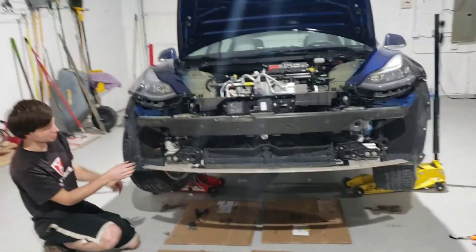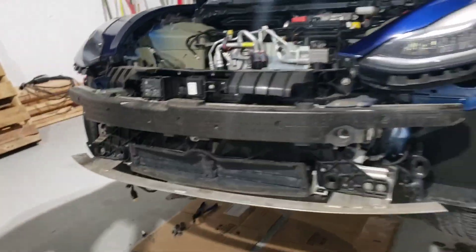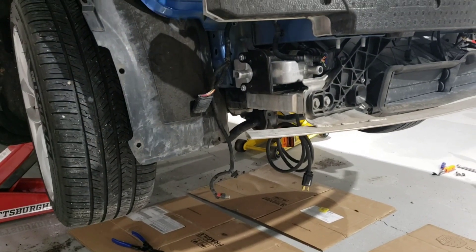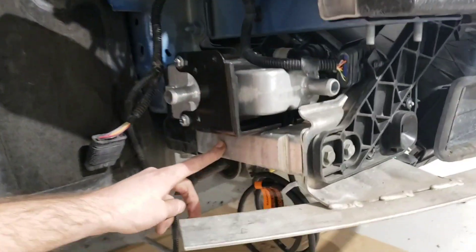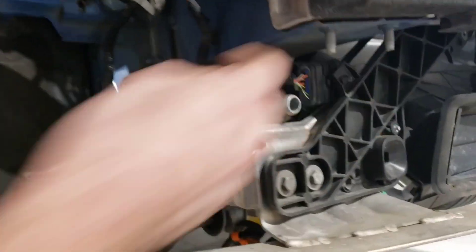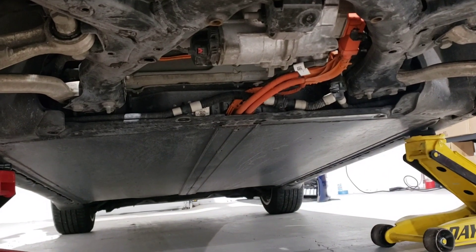So now we need to drill and secure this. We're going to rip everything off here so that we can get the holes in alignment for this bracket. Then we're going to drill and tap this aluminum beam right here, and start routing the coolant hoses to the circulation tank heater, which is all the way back there.